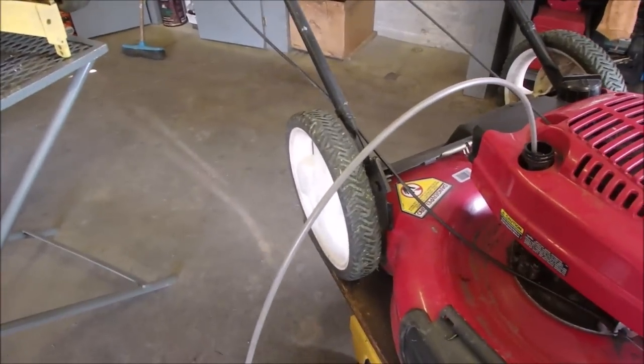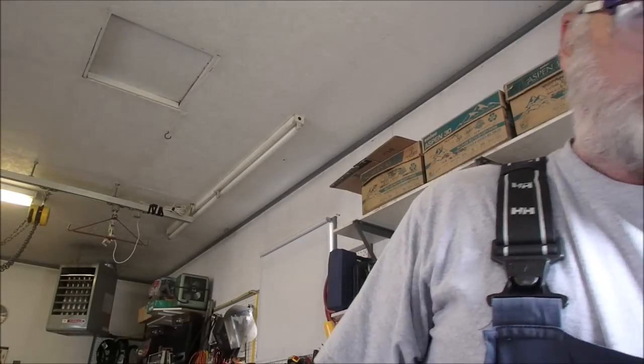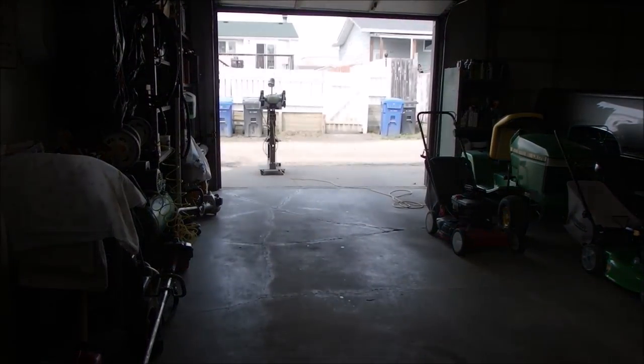Just to keep you informed, I get asked this quite a bit. Well, my friends, get a hat on here. The operation was a success. I did put a new air filter on there and sharpened the blade, of course. You can see that right over there, me with that grinder. That was kind of rewarding. All started from dirty gas, but I did find a cracked primer bulb that was still pumping. But that's probably why she had to pump it 10 times, not 3. Thanks a lot.